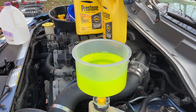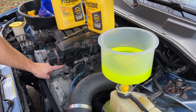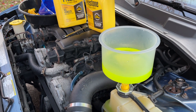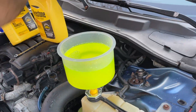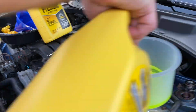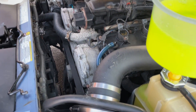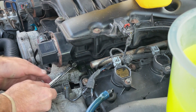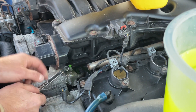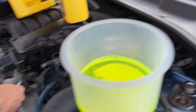Basically right now it's a waiting game. When I see liquid coming out of the bleeder valve, that means the system is topped off. It's spitting out a little bit now — we want bubbles, and once the bubbles stop that's when we know there's no more air in the system. I have a steady flow here now, so I can tighten this back up.